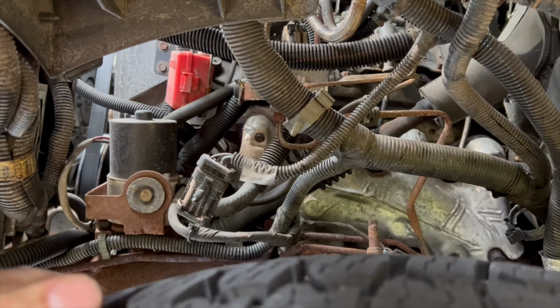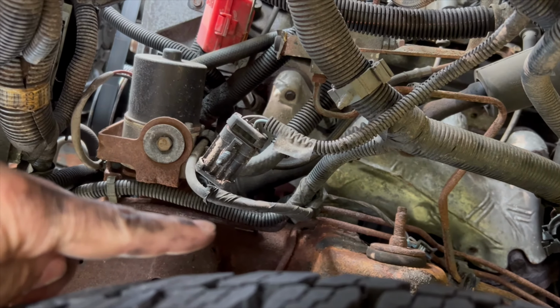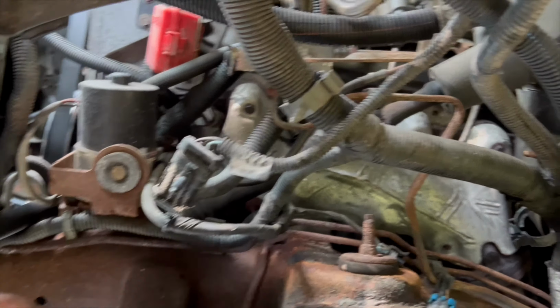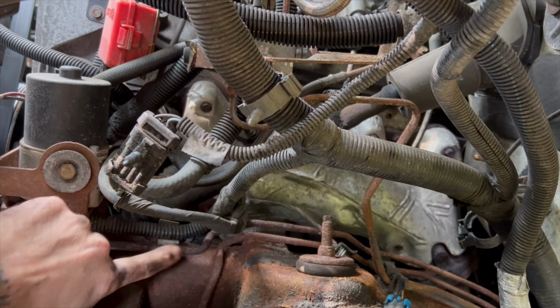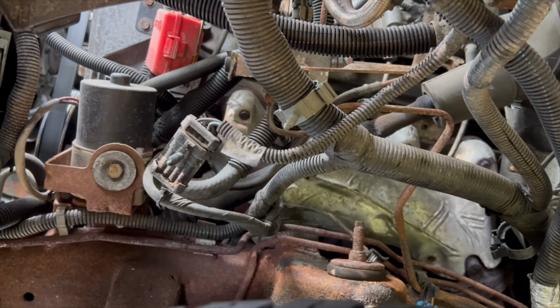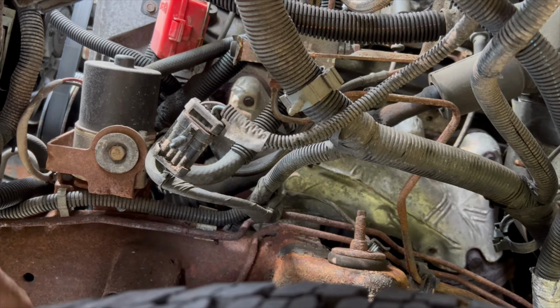It's going to kind of stink if they don't seal up because they are stainless, but I didn't really see anybody say anything about them not sealing. But I know stainless inherently doesn't like to seal very well, so I figured I'd give it a try. So I took the wheel well liner out. Right there is where I had my leak, and it was running down the side of the frame because of these little clips they like to use to impregnate the rust in there. So right there is where it started leaking.